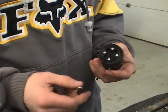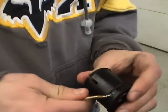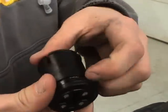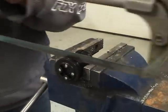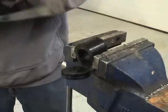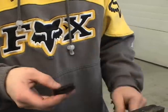After removing the stock magnetic plug for the speed sensor, you want to take off the o-ring. Now we're going to cut it along this o-ring groove with the hacksaw. Then we can clean up the edges with the sander.